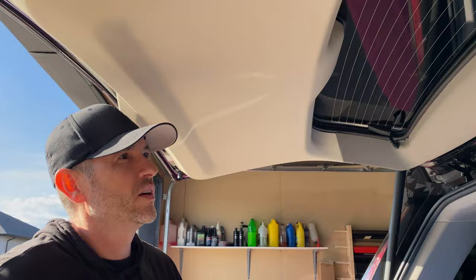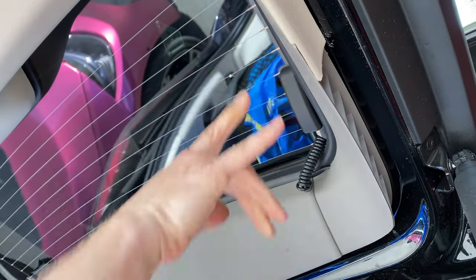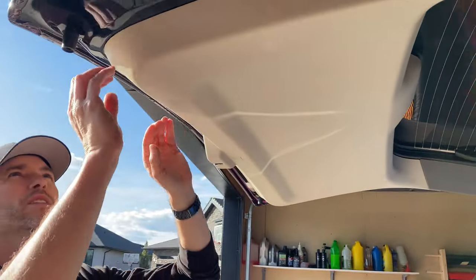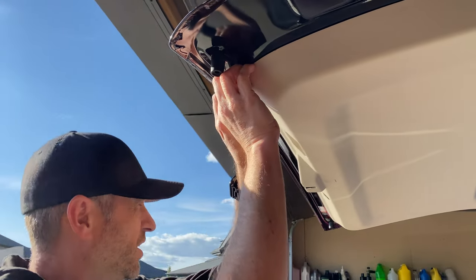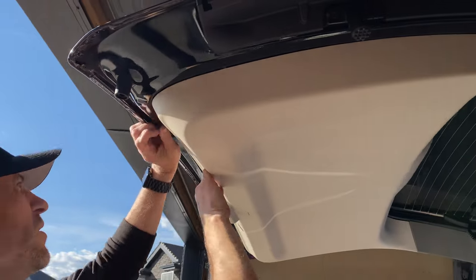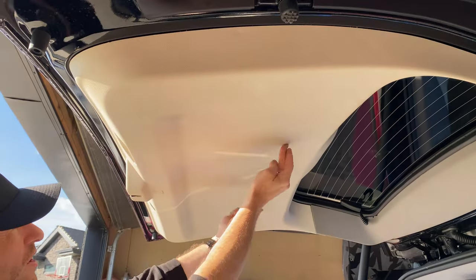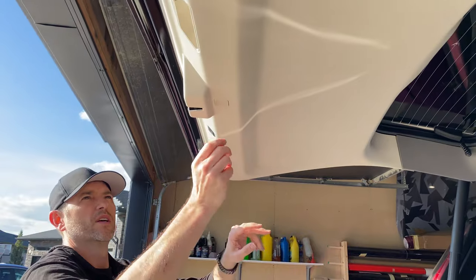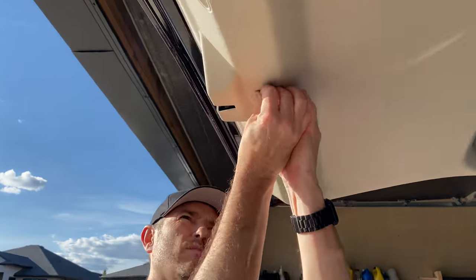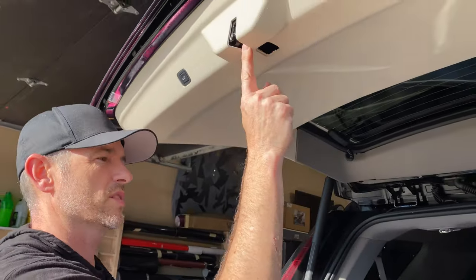Then you need to undo these clips that are sandwiched together in here. There are some little clips that just hook on with pressure. You want this panel released from the top panel, then you just get your pry tool or fingers in here and start pulling the panel out — they're just pressure fit clips. Once the bolt is out you'll have a little bit of leverage with the handle and you'll pop, pop, pop. There are two or three here, a couple up top, and some more at the end. There's another little cover here — that's just to gain access if you needed to manually override the latch from inside the back.